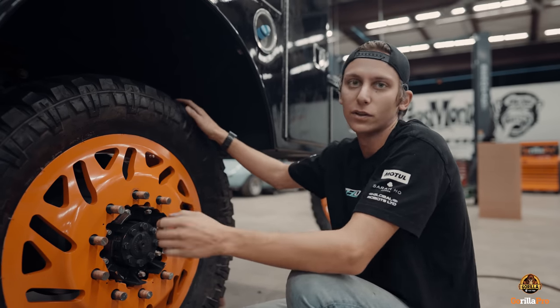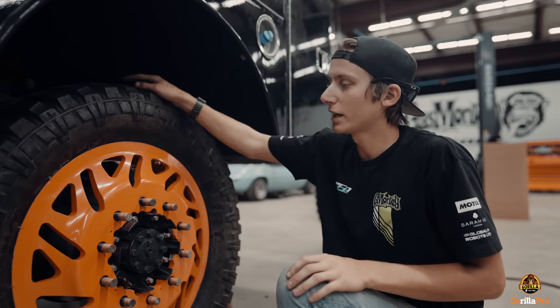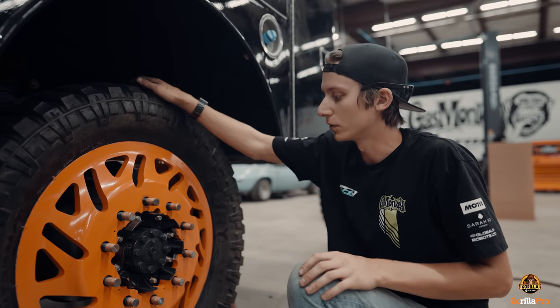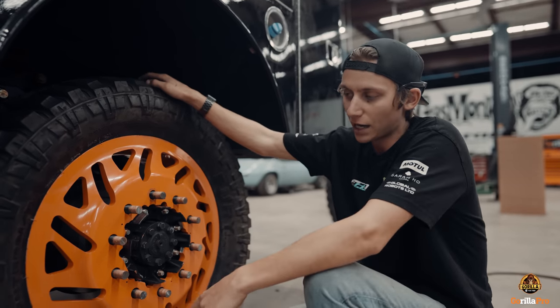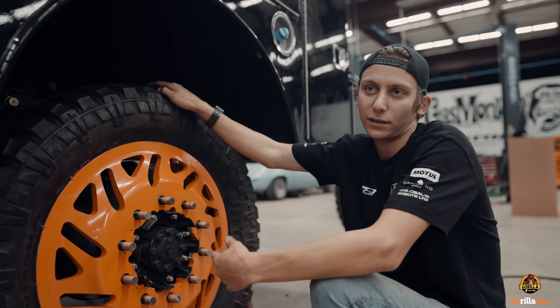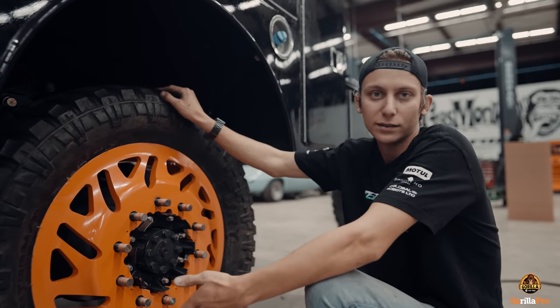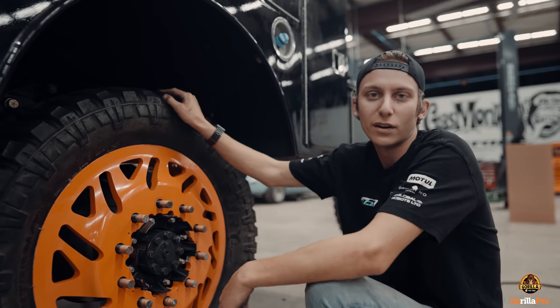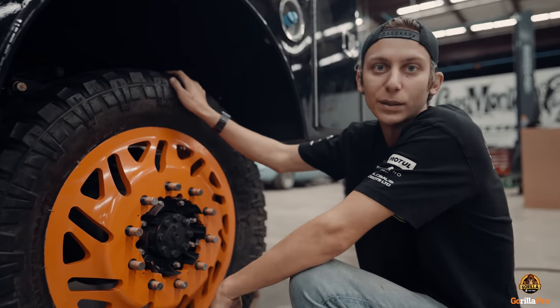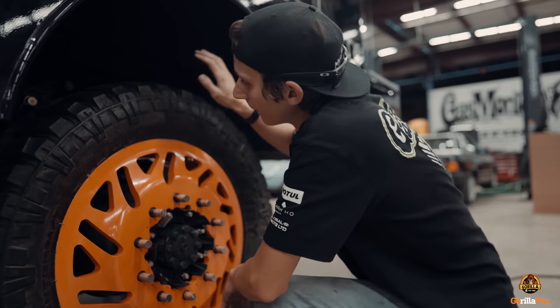and make sure we have clearances everywhere. So if this thing articulates in a ditch or something, the coilover's not gonna get rubbed and break a spring or rub through the tire, and we're not gonna get hot spots if they decide to put 20,000 pounds in the bed. So, not that this truck can haul 20,000 pounds in the bed, but if they decide to do that, it's not gonna get destroyed. So we're just covering our bases, and then we added our anti-seize, make sure everything's torqued all good. No wheel spacers are coming off, nothing's breaking.